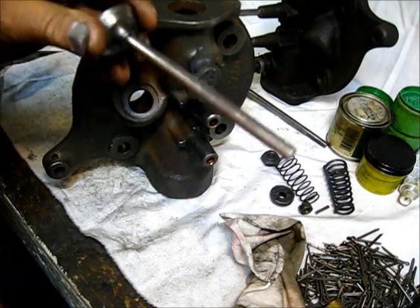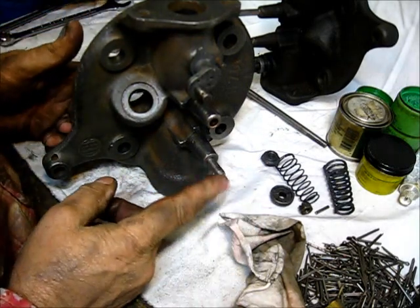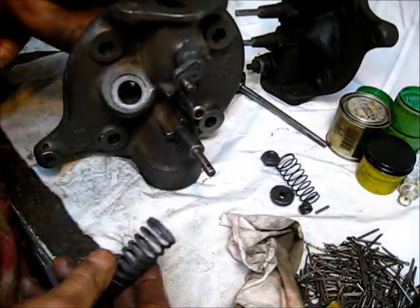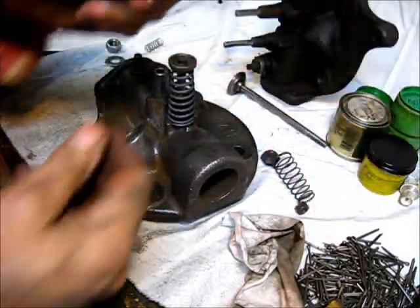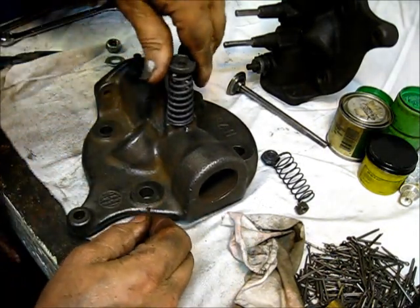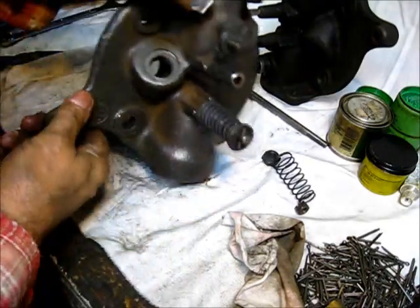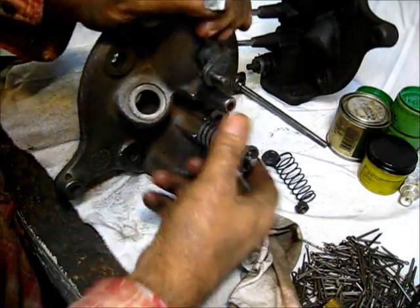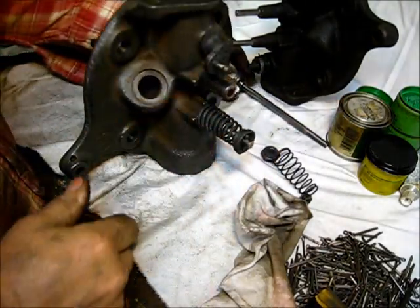With just a drip of oil on it, run it up in the hole. You see that — there is no side play. I'm making a point of that, but there is none. Put this down there like that, put that up here like that. We made a new pin — observe where your holes are at, don't be fidgeting around. Push down on this right here and put that pin in to where it fits in behind those two things. Now we've got that exhaust valve on there — that's good to go.